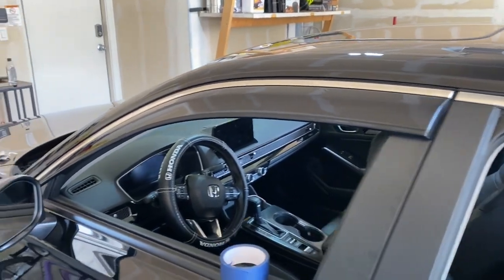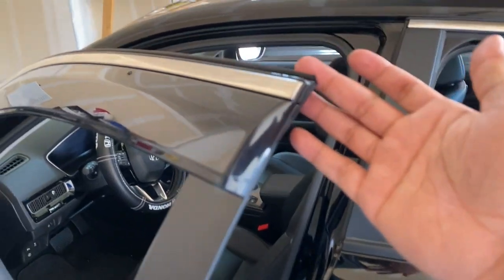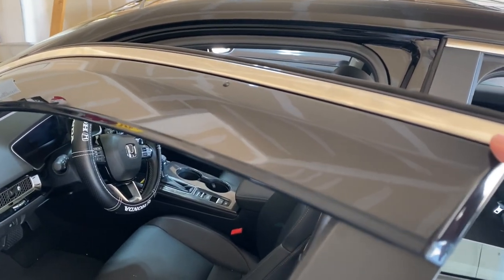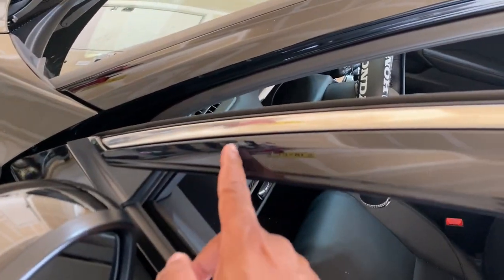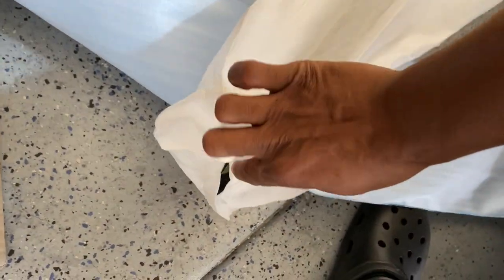This thing is easy — a piece of cake. Now that we've got the front on, let's knock out the back. You can see how the curl matches the chrome that's already on there, and fitment-wise it's actually pretty good. To save time — rather than putting tape based on measurements of the holes, you're better off putting the visor on first, marking where the hole is on the visor, and then going underneath to put the clip. The way I did it I was off a little bit on this one. Let's knock out the rear now.